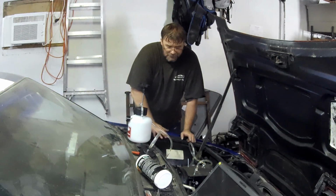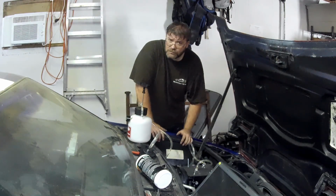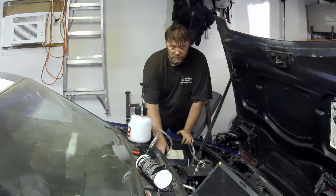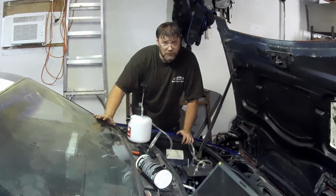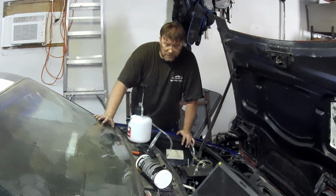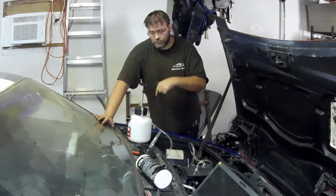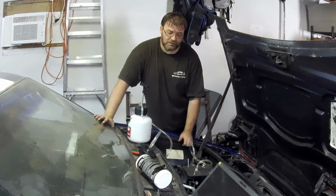Next, we have to do it to the clutch, but I am waiting on that dash 3 AN braided line. We're going to run it directly from the clutch master cylinder to the clutch slave cylinder and see if we're still having that big problem with way too much pressure on the clutch hydraulics. If I can, I'll put in some footage that actually shows the brake pedal assembly under the dash flexing when you press the clutch.